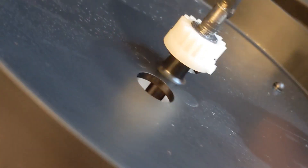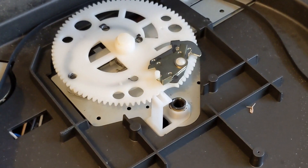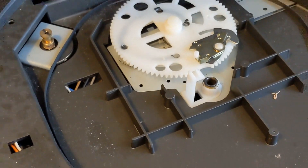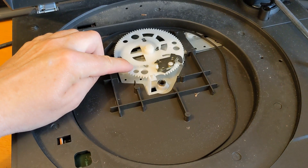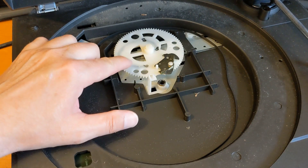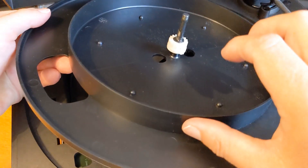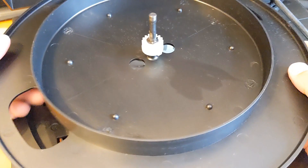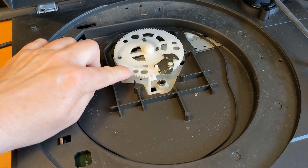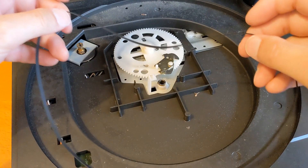All right, let's have a look at the back of this again. That gear must be for something. If this is the motor spindle... oh, I know what that's for - it's for the return. This must be the mechanism that when the stylus gets to the runoff, it picks it up and moves it. So the motor drives the belt, the belt goes on the outside of this part and spins the whole thing round, and that gear acts on this gear for the return of the stylus arm.